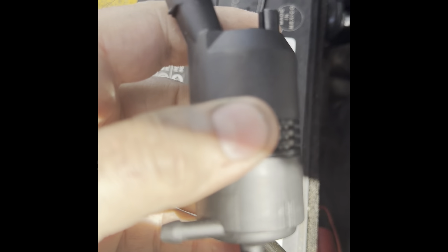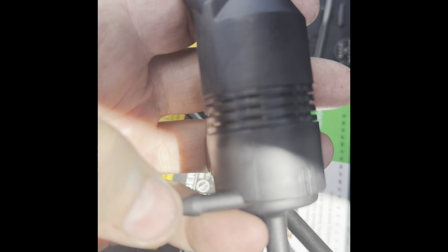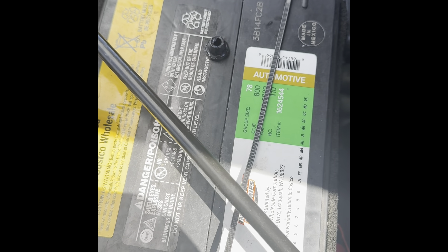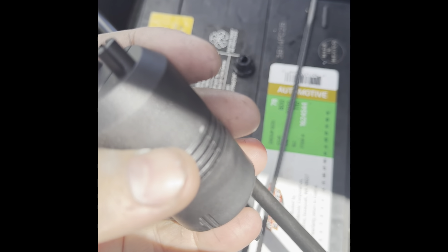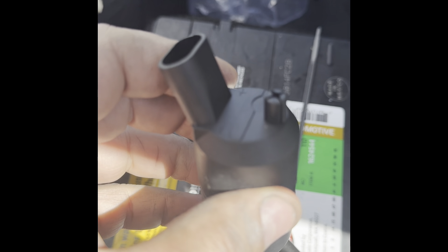The orientation is this way. What happens is that stem there gets pushed down into this grommet and pushed into the tank, and this up here helps it to clip on. Then you have your hose here and your electrical connection up at the top. To pull it out, you pull this way — it's going to pull out of that old grommet. Then set this into the new grommet, push down into it, snap it into place, put your hose on and your electrical connection.